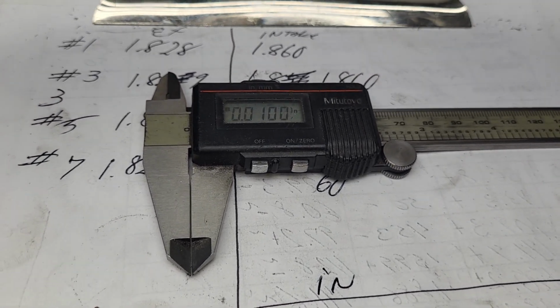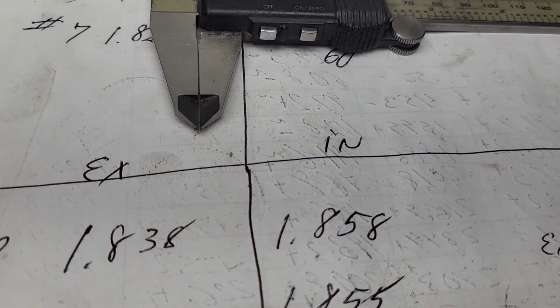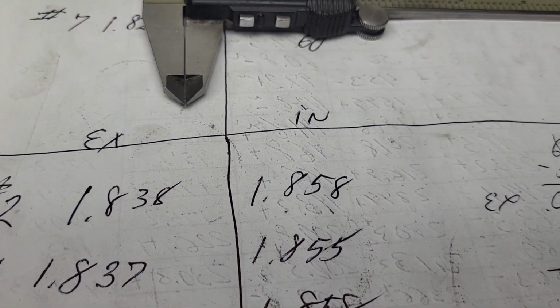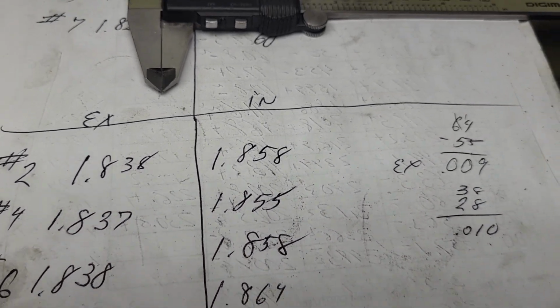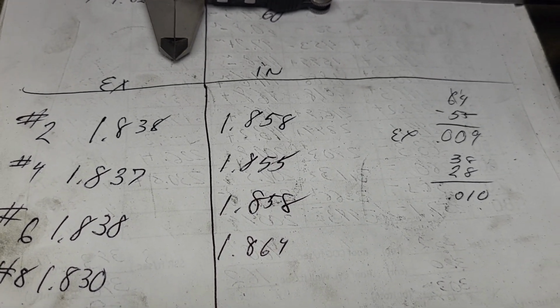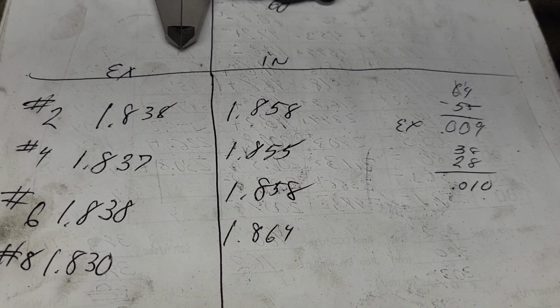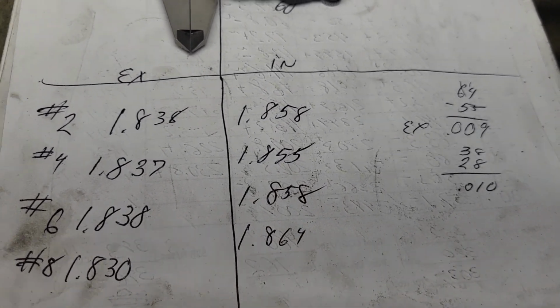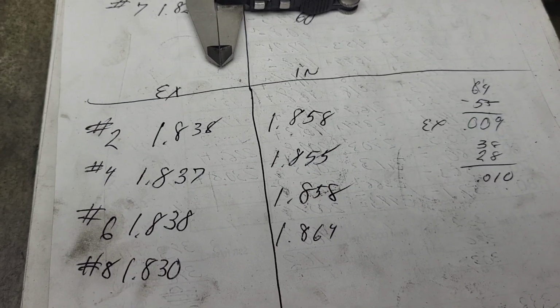It's got adjustable rocker arms, adjustable valve train. This is going to have a hydraulic roller valve train. It's going to have good rocker arms on it, probably like a Comp heavy duty roller. It won't be a problem. But if the customer sees this and says, hey, Charlie, I'd like you to even them up a little more.